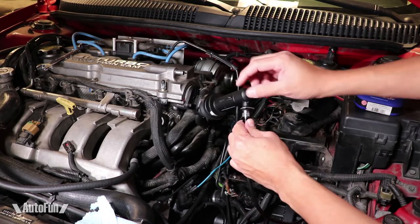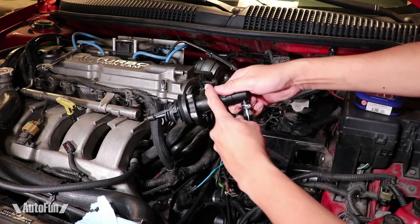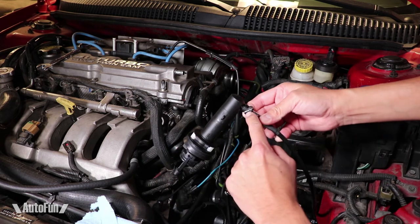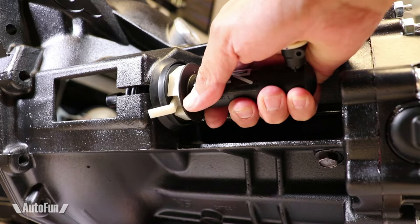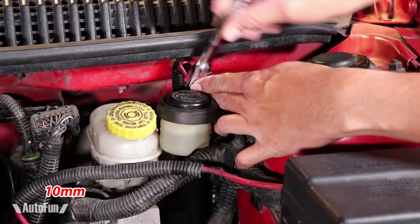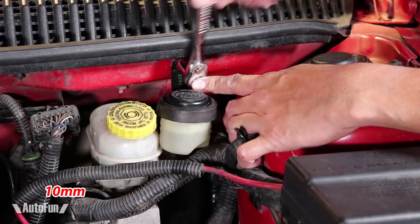The slave cylinder attached very easily. I pulled the temporary cap off the line and, careful not to lose too much fluid, I quickly inserted the line into the slave. Then while holding the line down, I carefully inserted the included roll pin using a small hammer — this locks the line in place. Finally, a cotter pin is also installed here to secure the roll pin. Going back to the bottom of the car, the slave is installed by inserting it into location and turning until it locks in place. The last step is to bolt down the reservoir using a 10mm socket, then bleed any remaining air out of the system and readjust the clutch pedal rod. Check out my video on how I adjust the clutch pedal rod — I've placed the link in the description below.